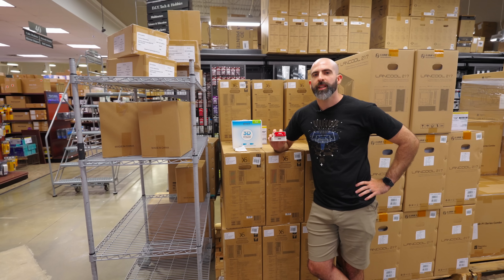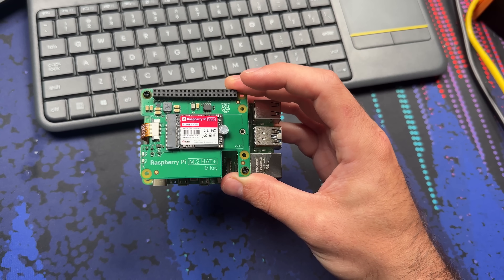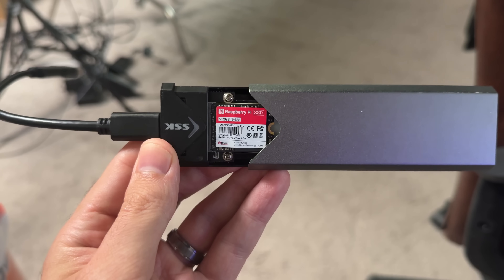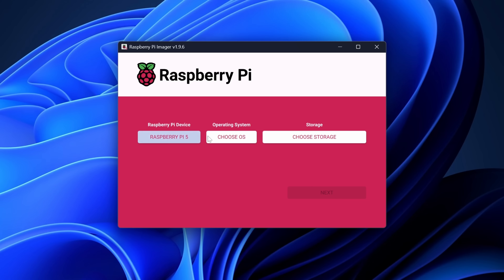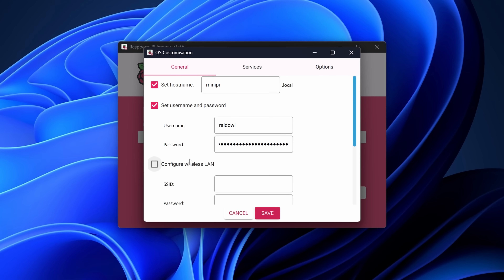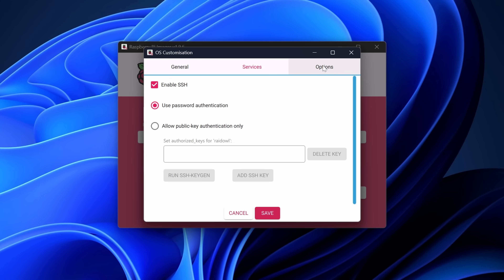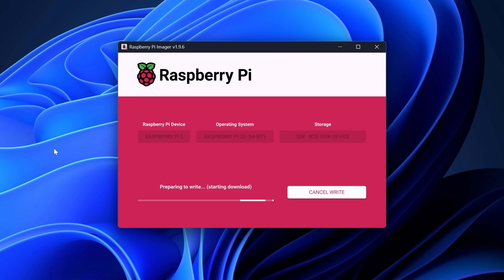So let's go home, set this up, and see how this works in terms of software. One of the main benefits of using the M.2 hat with an NVMe drive is that the Raspberry Pi will run the operating system much faster. To get Raspberry Pi OS installed on the NVMe drive, we'll use a USB to NVMe adapter with the Raspberry Pi imaging software. Using the Pi imager is great — you select the OS, configure hostname, password, SSH, and it bakes it right into the install. Then select your NVMe drive and you're done.